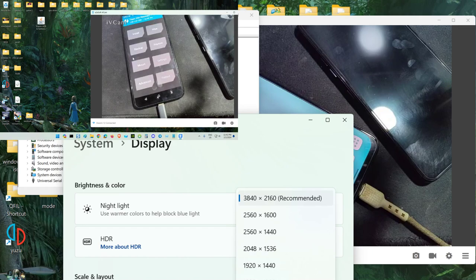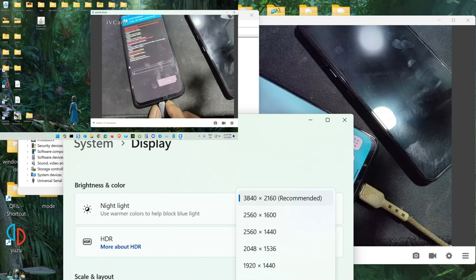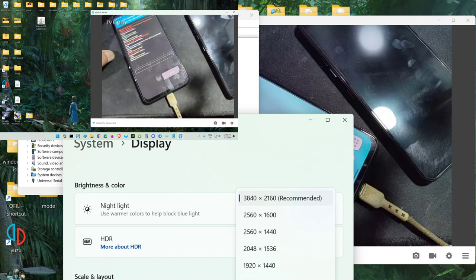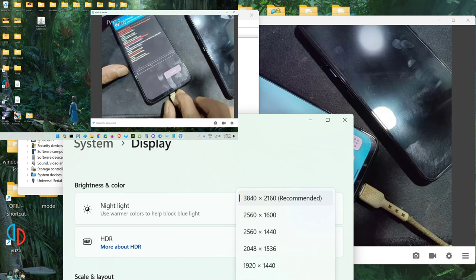Let's see which partition is active. Still slot A. Whether we can sideload with this recovery. Advanced, ADB sideload, wipe cache and Dalvik. Swipe. Start, detect. Oh, sorry, I have to connect the cable to the PC. It's not detecting. That's the problem.